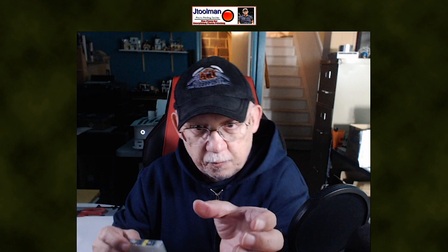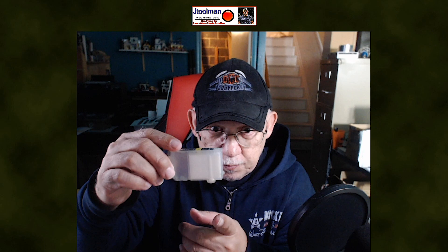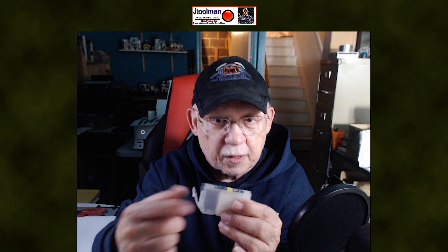If you've never done this before and want to make sure your cartridge is flowing enough to feed whatever demand your image requires, run this test: get a cup or can you don't care about getting dirty. Remove the clip and hold the cartridge — it is full of ink — over the cup with the plug installed. Ink should not dribble out. If it dribbles out, your plug is not sealing. Remove the plug: now it should drip steadily. After four or five drips that's plenty — you know the cartridge is flowing correctly. Put the plug back on, put the clip back on, and top it up to just underneath the plug.